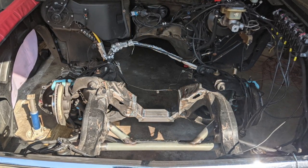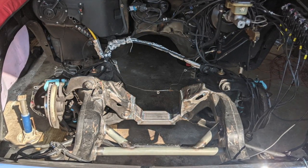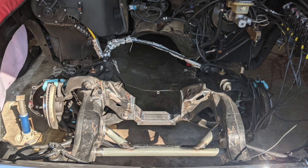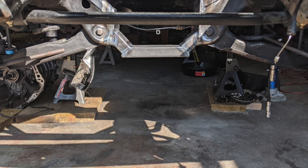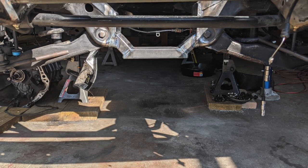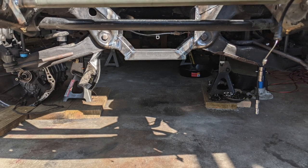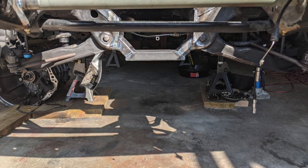One of the challenges with it being so narrow is getting the mounting points correct, getting the rack and pinion travel correct, and the flexural points for the tie rods have to be in the right spot to prevent a lot of bump steer or weird steering geometry angles. So those are the next impasses we are going to go through in this video.